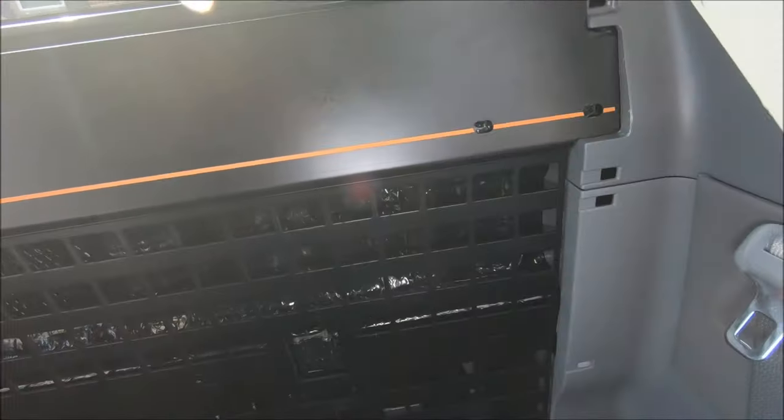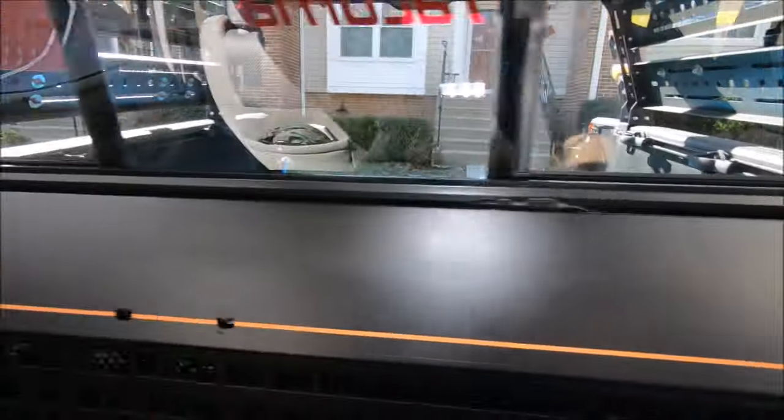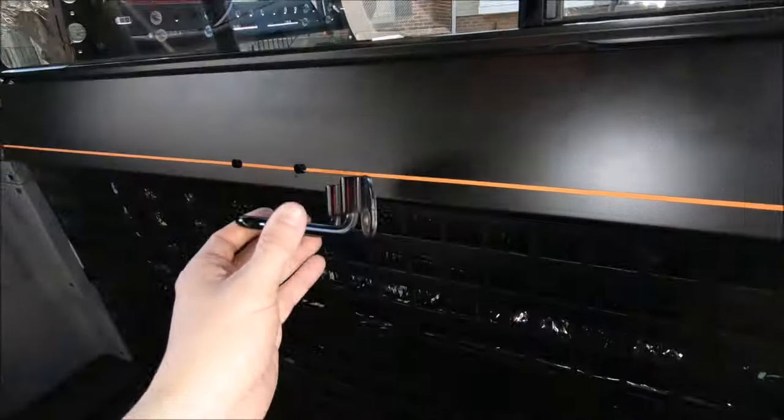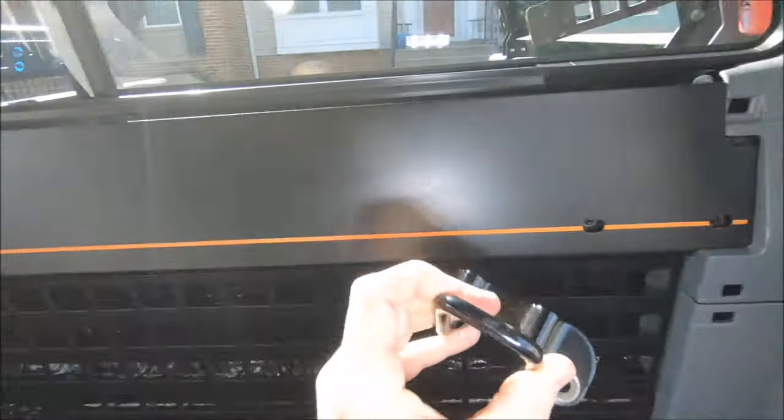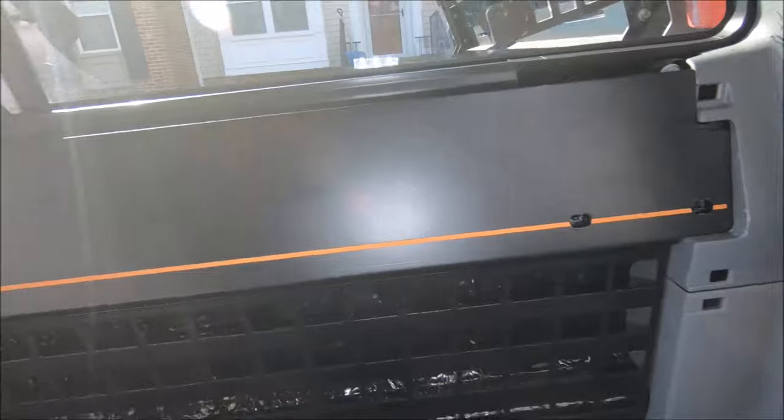And there is the painted rack. Just wanted to show you the final fitment. You can see right over here, nice and tight on both sides. I have seen people post on Tacoma World, if you are reusing these seat brackets right here, they go one right here and the other right over there. These are the parts that actually catch the folding part of your seat when you slam it backwards. Since I am not reinstalling my seats, I am not going to reinstall those.